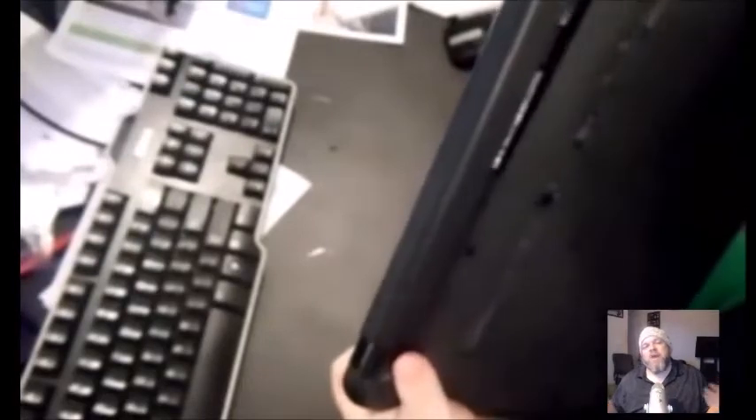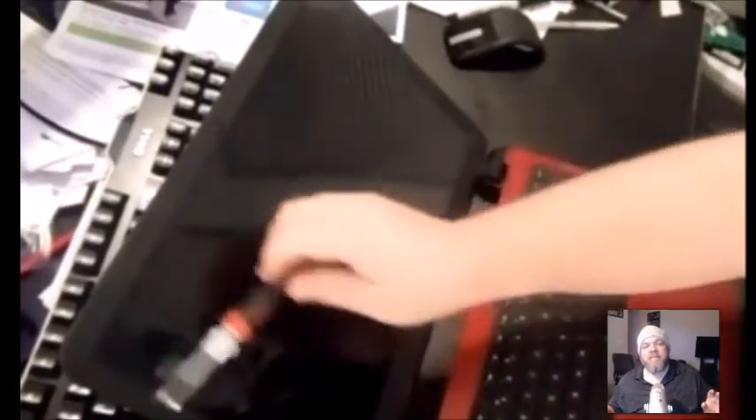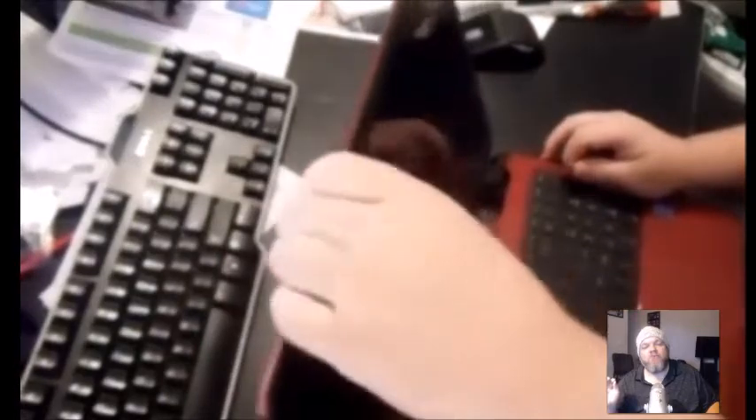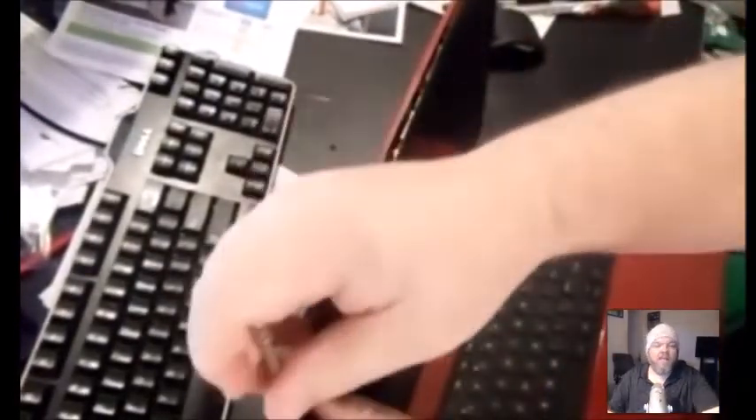On this one, the battery just slides out of the bottom — there are little grooves you pop open. Next, you want to take the plastic bezel off your laptop — it's almost like the frame of a picture frame. Most screens have little end caps on the corners. You want to pry those off using a small flathead screwdriver or even a butter knife. Once the end caps are off, unscrew the screws on each of the four corners.